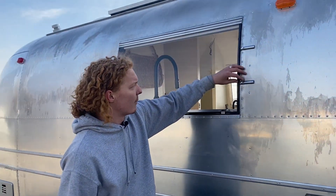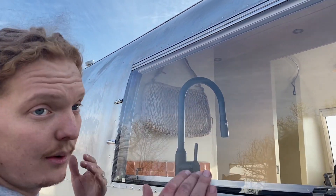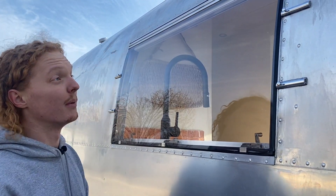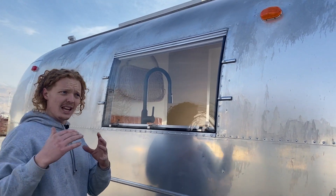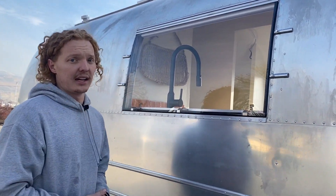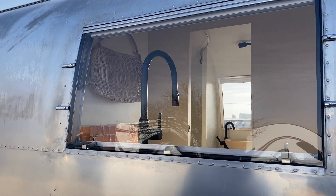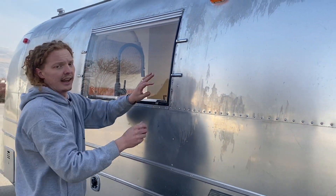We've got what we call storm latches. We went with Lexan windows on all the side windows that are curved — these are frameless, as Airstream did originally for these models, making them pretty unique. They obviously don't make new tempered glass for it, so Lexan is your best option. Lexan is extremely durable, very high clarity, and will last a long time before it needs to be changed out. We added these latches so that when you're towing, the windows can't flap around.